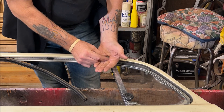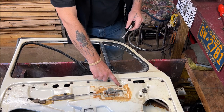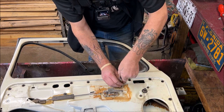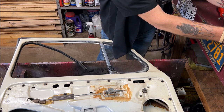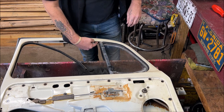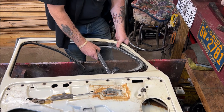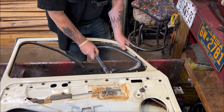There's a little Phillips screw and a washer. We're also going to remove this 10-millimeter bolt because the rod goes down and holds the vent wing in place. Screws out, bolt out — there's nothing holding the vent wing except a little stubbornness. Okay, that's loose and out of the way.